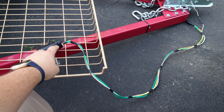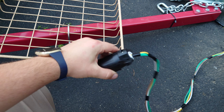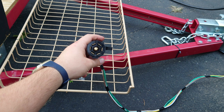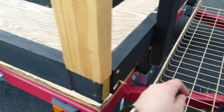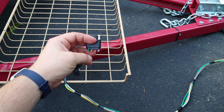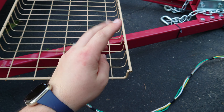So got it all done. Taped up the section just to keep the wire tight, and we'll keep it tucked away when I'm actually using it. Tighten down that little set screw there — clamps down the white part, which helps make it water resistant. And it works: left blinker, right blinker, brakes, hazards. This trailer doesn't have any brake control or anything like that, it's just a small little trailer. But that is how you turn a four pin — so your lights and your ground — into a seven pin with lights and ground. That's all we got for today, thanks for watching, till next time.